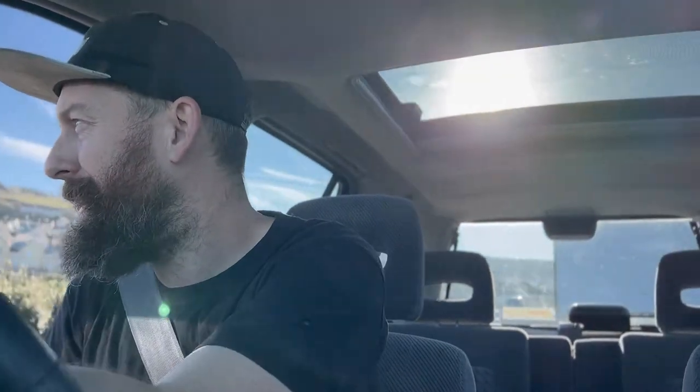Round three. I've now taken all the mud flaps off because they're just dragging across the floor, and I've wound all the suspension dampeners to hard. Let's give it a go. Oh my god — we're still bottoming out! We have to figure out a way of creating an extra cavity for that ball joint arm to sit in. I quite like the way it looks at the moment — the ride height is perfect — so I'd rather not have to raise it. We'll have to figure something out.